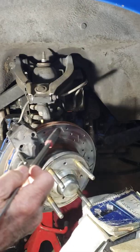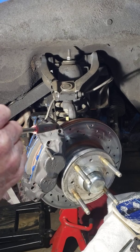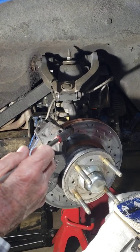I'm using dual-plated rotors, cross-drilled and ventilated. This system is not as light as something like Wilwood brakes, but I don't have any brake fade. So if you're racing on a budget, it works pretty well.